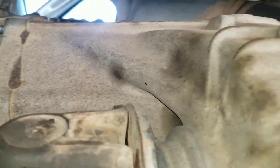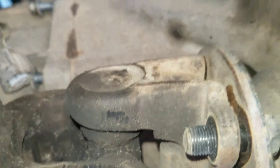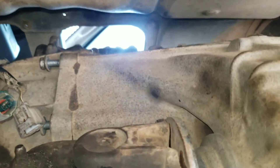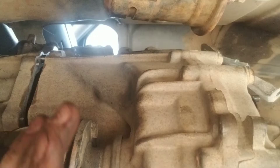I've left some bolts in place so it won't completely fall - though it shouldn't anyway because it's got an input shaft that goes into the transmission. I'm going to practice a little safety here. I'll unbolt the other two, get a jack under here, and get this thing out of the way. I may not film the actual removal in case I have to go to urgent care - I'll let you know.